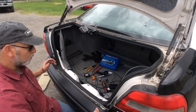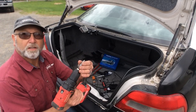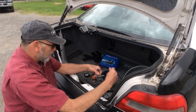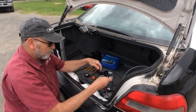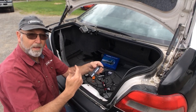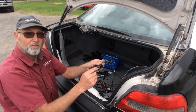Now that all the sensors are installed — this would have gone a little easier and cleaner if I'd used the hole saw, but it's not designed for metal, only plastic. Also, the unibit doesn't give a very clean hole; it leaves a little ridge so you have to finagle it a bit. Now I need to choose where to put the control box. I'm going to put it on this side of the vehicle. You'll want to mark your wires — they go from A to D — so make sure you put them in the right location. On other sensors I've used that made a difference, but since this one is just an alarm with no display, it may not matter. I'm going to label them A, B, C, D anyway.